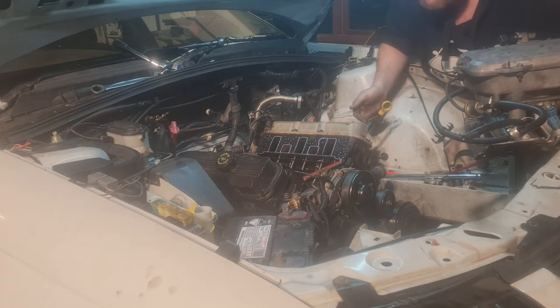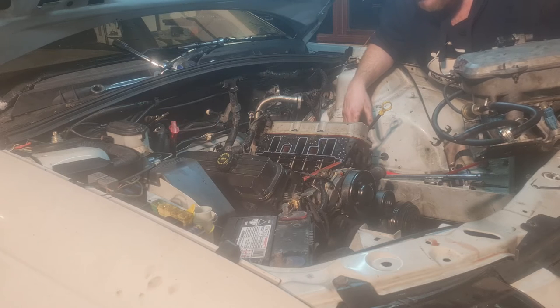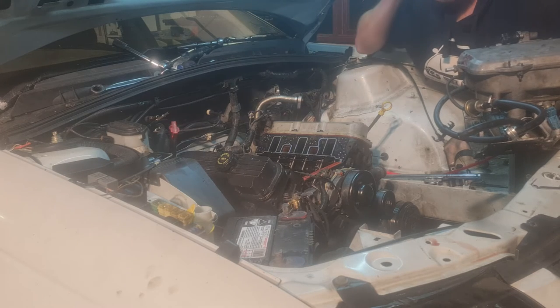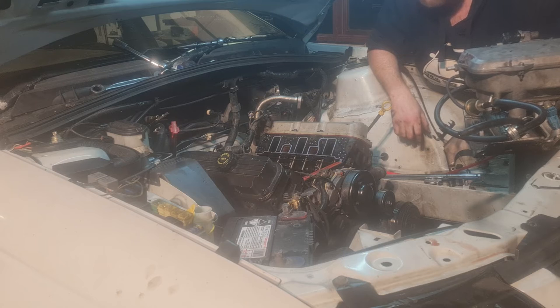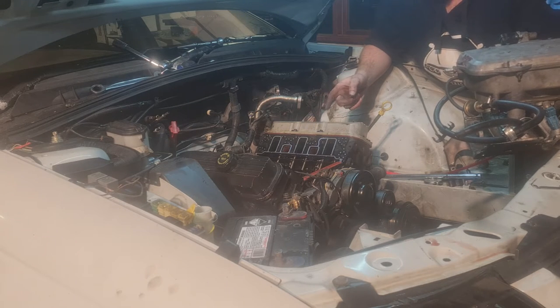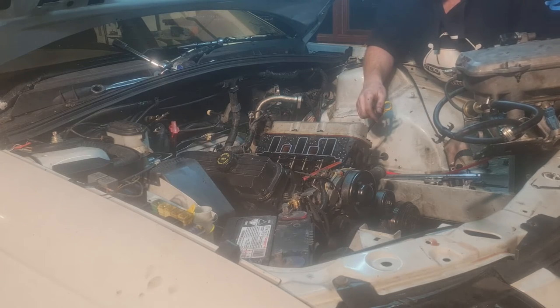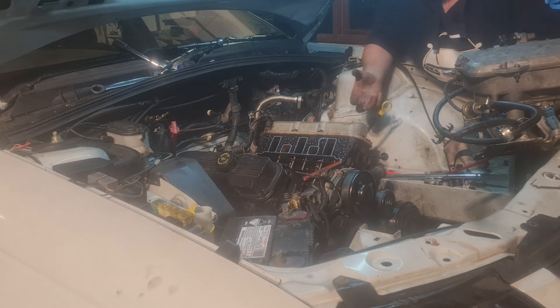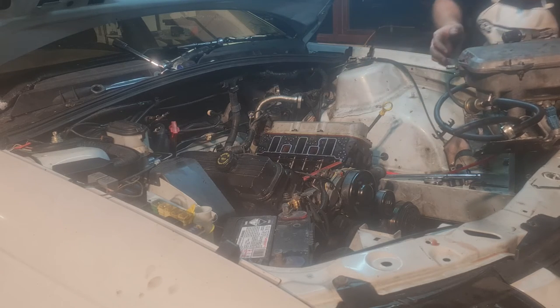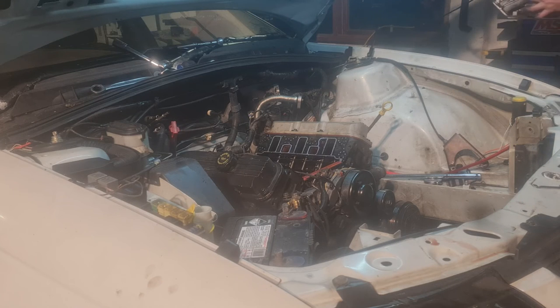So a little bit of water. Unfortunately, a little bit of water has seeped in, but there's really not much I can do about it. I'll get some rags and clean that up. Looks pretty good from last time I was in here. Benji had taken all the valve train out last time. He had soaked the lifters in degreaser and the plungers were stuck because it's a hydraulic lifter. It flat out refused to plunge. So we cleaned all that, put them in. It still made a racket. So at least we did a nice service, which means those lifters may not be totally junk. Some good spares.